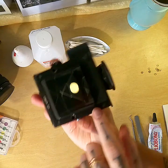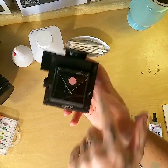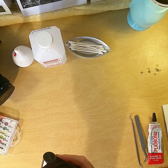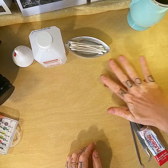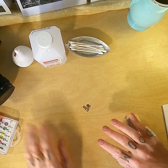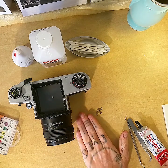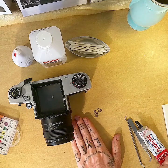And then found out that if I took these off, there's a little piece, this edge right here, the serial number on it, that you screw in with four screws, wasn't sitting flush. And I had spent a long time in the past trying to get it to sit flush, and I thought by putting these washers in different levels it had worked, but then it wasn't locking into the Kiev. So this time around, trying to make a video about just how to set the prism flush, I realized these washers are not necessary at all. And they actually make its job a lot harder.